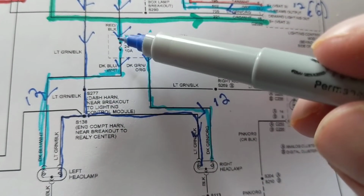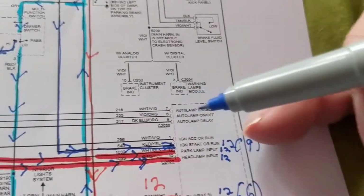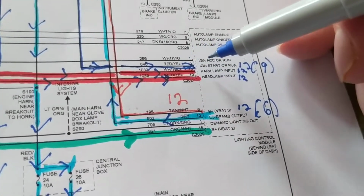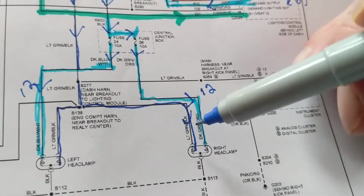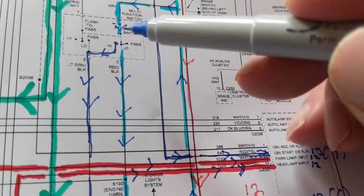Now, as you see over here, we should get 12 volts. We didn't lose anything. This might be switches in here or transistors. So my guess is if I have 12 volts coming in, I should have approximately maybe 12 volts coming out to light these filaments, around that. So that's fine. That's in low beam.